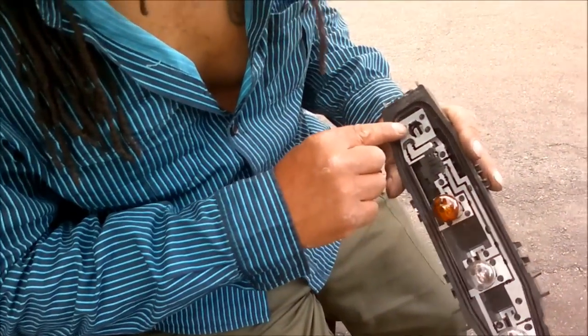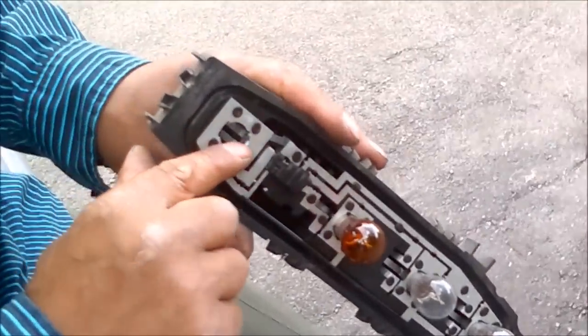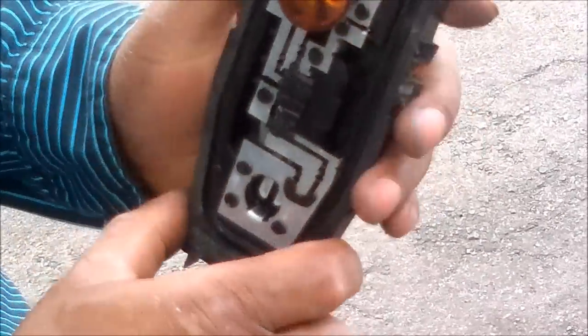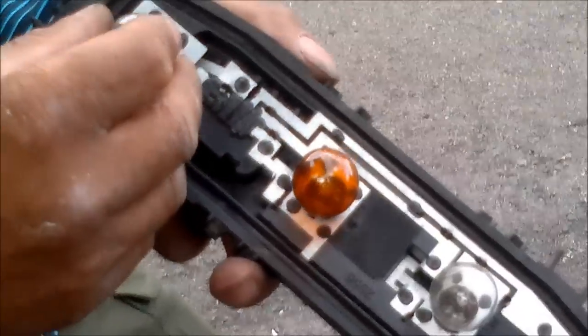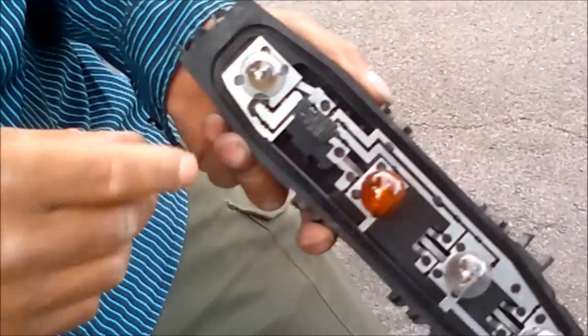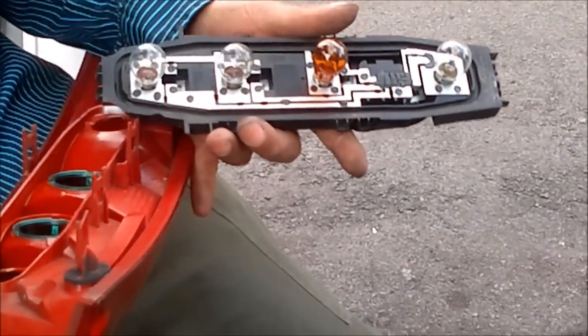Here's our bulb — you can see one pin up, one down, two connectors and two filaments inside the bulb. On here you have your grooves where your bulb sits in. Take notice when you're taking them off — one is low and one is high. Put your bulb in just like that, press down on it and twist — it should lock. There's a seal here which you can take off if you like and fit it in properly.